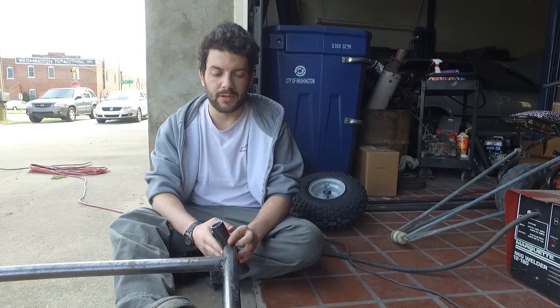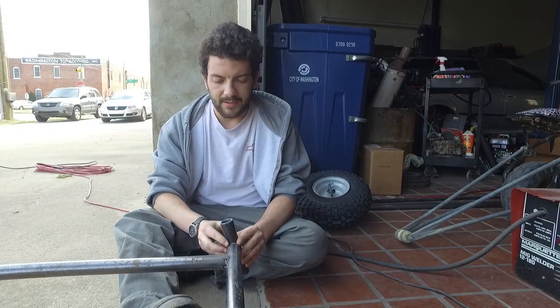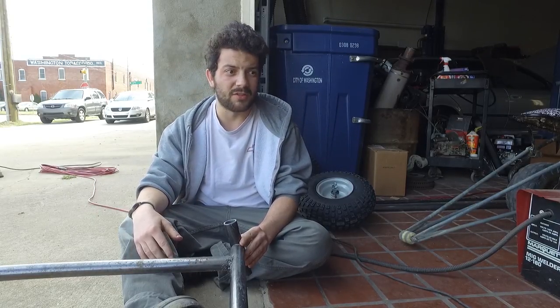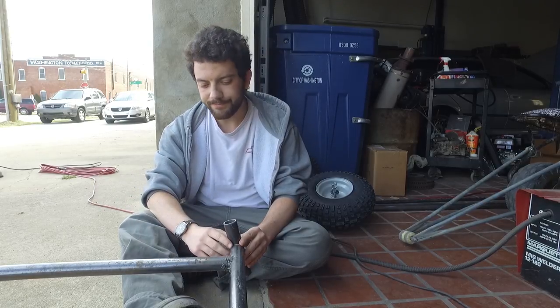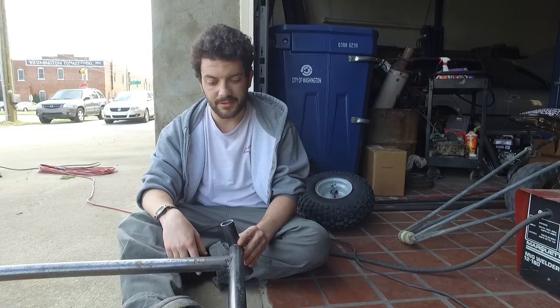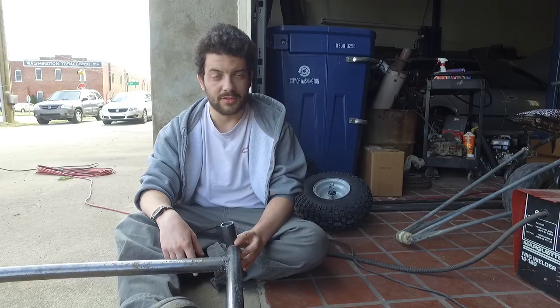So the whole thing with Ackermann steering, or when you have caster in it, is when you turn left or right one of the wheels is going to lift up a little bit, especially when you have fixed suspension like this. Basically what we don't want happening is going around a corner and when all four engines are at full throttle, one of them lifts off the ground and spins wide open in the air — and then when it comes back down it's going to torque steer. Plus it's not good to hold an engine wide open with little load. So having Ackermann steering or some caster is better for high speed stability, and we're going to try to compromise and just have a tiny bit.